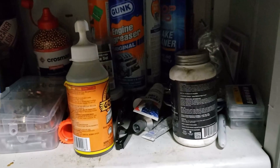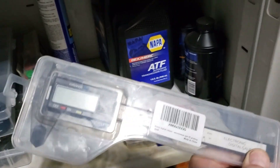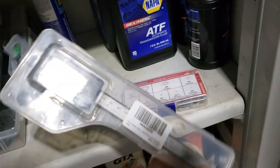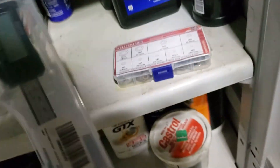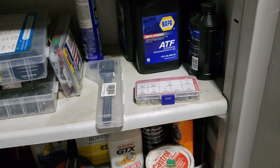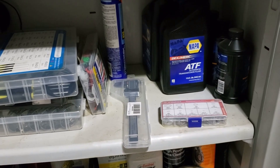When I get these carbs, here's a nice little item — this right here cost me eight bucks on Amazon. It's like a micrometer and I use it to adjust the height of the floats on the carburetors. You get a digital readout, something cheap since I don't use it for much else, but it does a great job measuring the floats — which is 15.5 millimeters for these particular carbs.